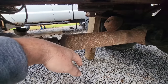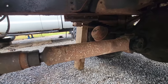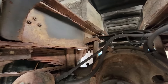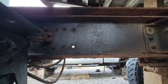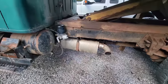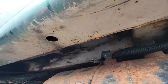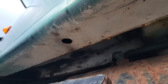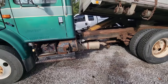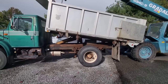Another problem is this is like your typical city truck — it's really not meant for highway use, and the previous owner needed to drive it 500 miles home. The frame is actually in really nice shape. It's a double frame with almost no rust jacking whatsoever — it's absolutely beautiful. It's a full drive, it's a DT 466 mechanical. The cab is in fantastic shape, and underneath the cab, the firewall and the cab mounts are all in good shape.